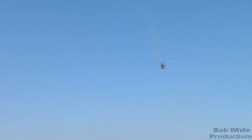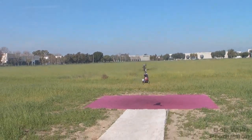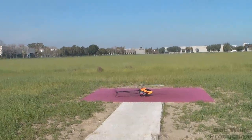See how it just puffed out smoke? It's kicking out a lot. It's nice and thin while loaded right there, and then I let go and you see that big puff — yep. Now we're too rich on the mid. The idea is you unload the head so you're in the middle needle at zero pitch, no load. The collective's dropping and you see that big puff.